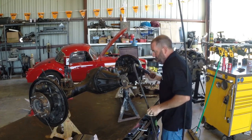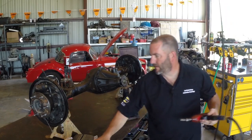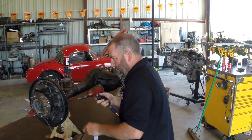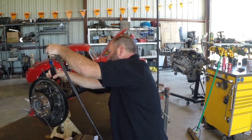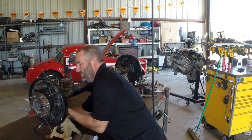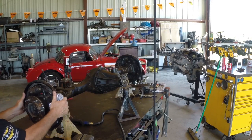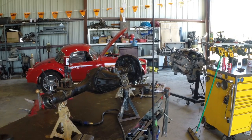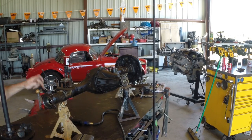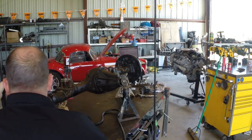Missing a bolt. These axles should slide out — may take a little hammer. There we go. So that's pretty slick: the axle, the bearing, the bearing retainer, our tone ring for the speed sensor — if it had it — all comes out all in one. That's kind of a piece of cake.